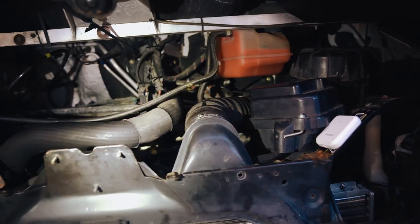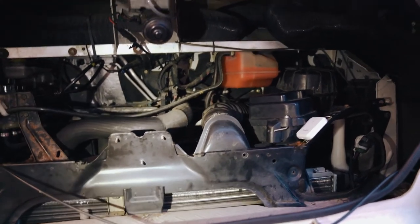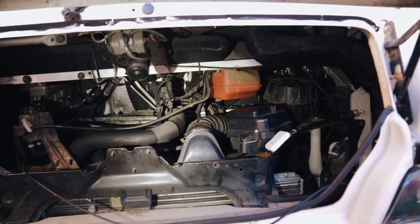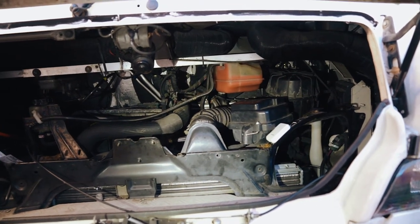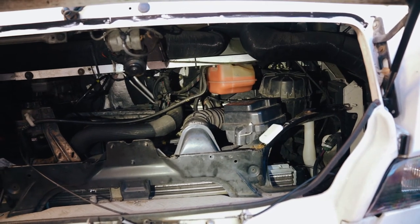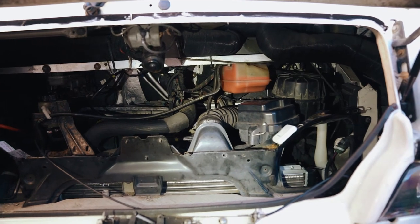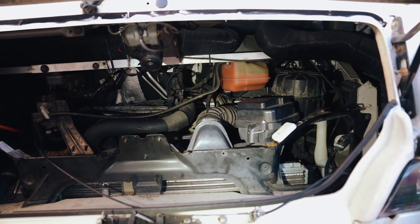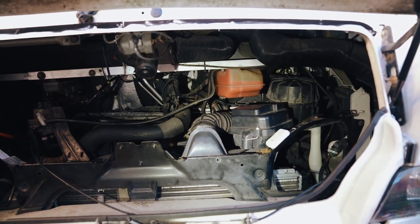Initially when Fiat manufactured this engine, they had put the amount of 2 liters of gear oil, and then what they found was that that was not enough to lubricate the fifth gear, so they then reissued the quantity to 2.7 liters. And so 2.7 liters is what you need in order to lubricate your fifth gear properly.